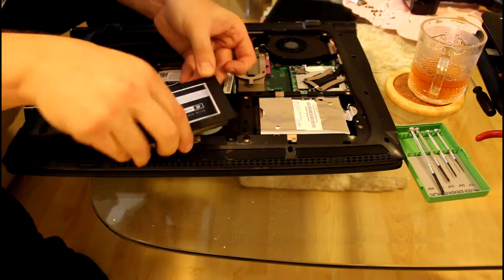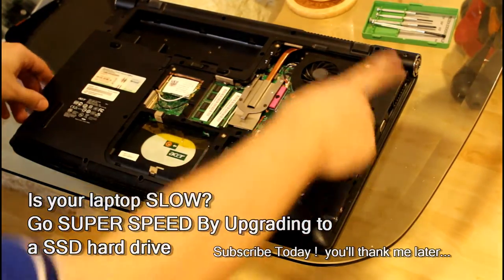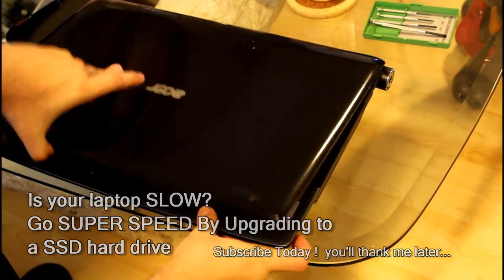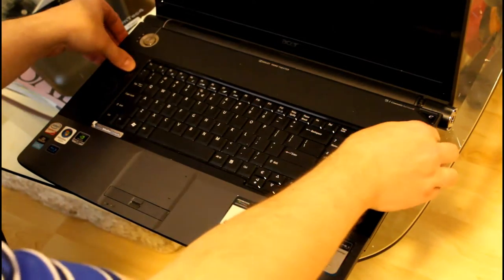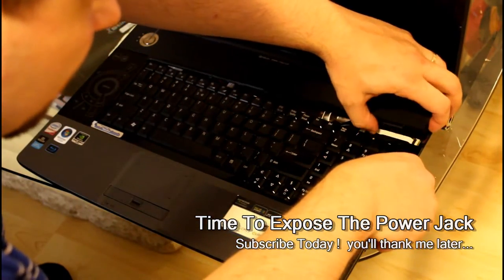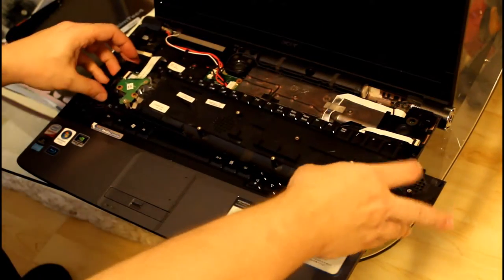On my particular laptop I had to remove my hard drives just to get access to additional screws, because I'm going to flip over the laptop and take off the whole keyboard area — remove most of the housing so I could get to the power jack. All my screws have been taken out already. Flip your laptop over. I already took mine apart a million times, so I know where I can start prying it up to show all the guts of the laptop. Everything is coming loose, and right here I'm removing that top cover which is right next to the power connector.